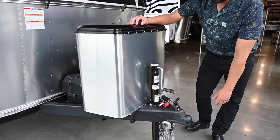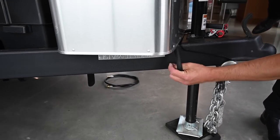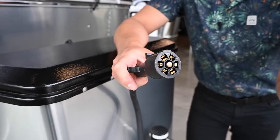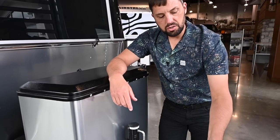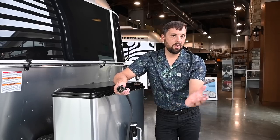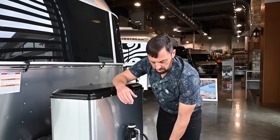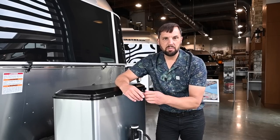You have safety chains here — always crisscross them before bringing them onto your tow vehicle. Over here is a seven-way connector, so your vehicle needs a seven-way receptacle. It handles turn signals, brake lights, and brake controller feed. It also has a charge lead built in, which is very important. Your vehicle will need either a factory brake controller or an aftermarket brake controller — we do the RED Arc controller here. This trailer has brakes and you're required to have them operational, so we do brake controllers on most vehicles.